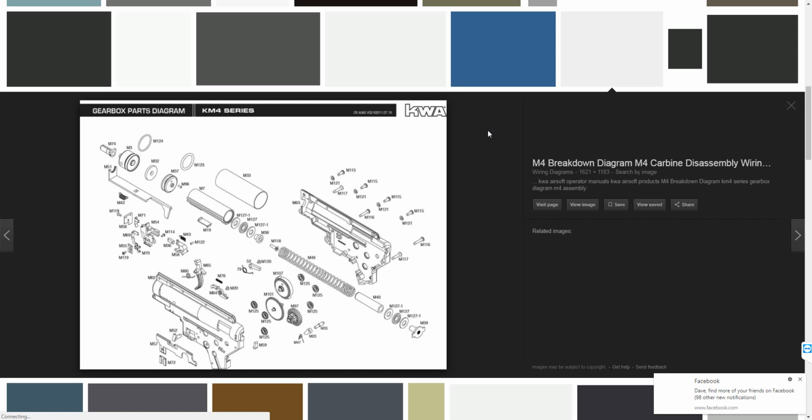There's already grease on there. It's silicone grease. Dielectric grease is better than silicone grease. It's a lot thicker. At least it should be. And then you put some dielectric grease over the Teflon tape. Some people put it under, some people put it over. You're supposed to put it under and over. Most people don't even do either of those, and you just stick it on like, dum, pum, dum. It's retarded.